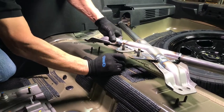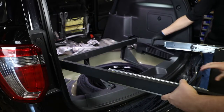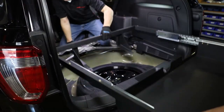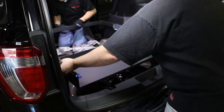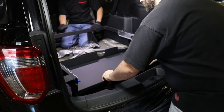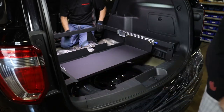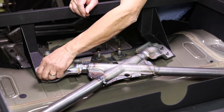Place a socket or block between the floor of the vehicle and the structural reinforcement X-brace, creating a space between the brace mounting flange and the mounting studs. With assistance, place the false floor frame and bracket assembly in the vehicle. Position the lower leg of the rear brackets over the studs and under the X-brace.